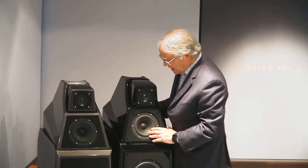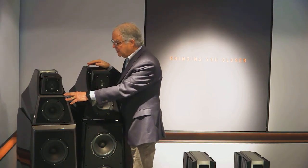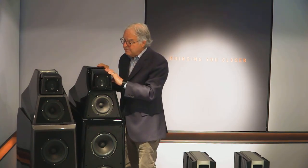The midrange driver is identical in size and shape to both speakers, but the enclosure that houses this driver has approximately 17 percent higher internal volume. We've also developed a much more significant way of handling the back wave pressure of that midrange driver. The result is a faster, more transparent, more detailed sound coming out of the midrange component — midrange being a pretty significant part of the overall speaker's sonic signature and characteristic.